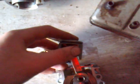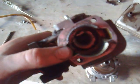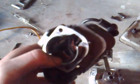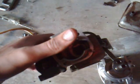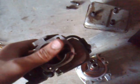Then when the piston comes down, there are little inlets on either side. When the piston comes down to a certain point, all this fuel will go past the piston and go up to the top. Then when the piston comes back up, it explodes the fuel. While it's at its highest part of the stroke and exploding that fuel, the other fuel comes in. Then when it comes down again, all the fuel comes up to the top and explodes it, and so on.